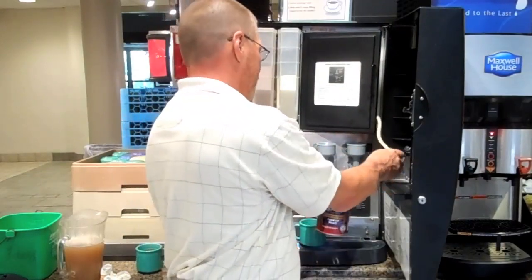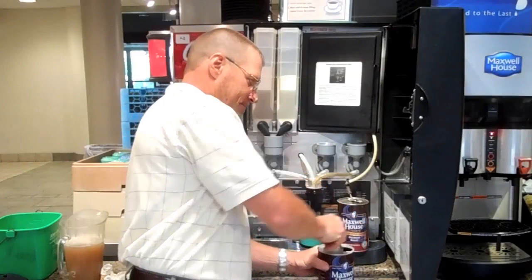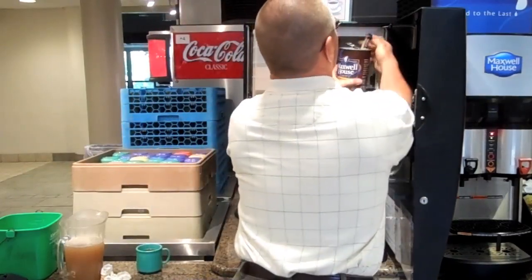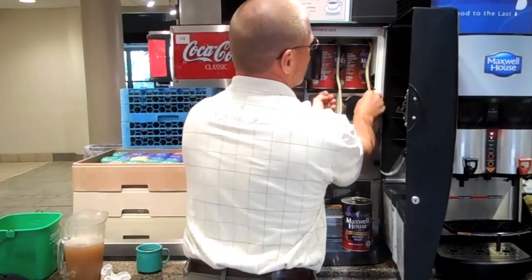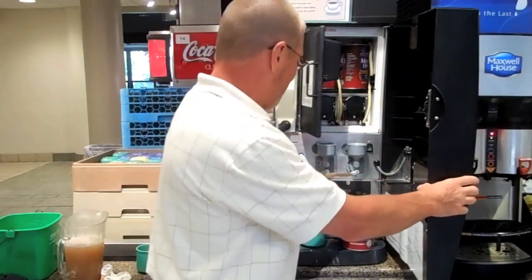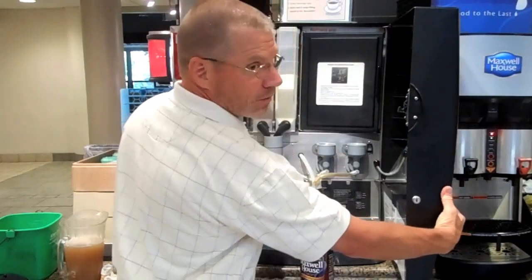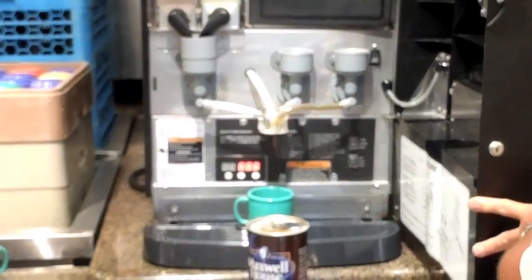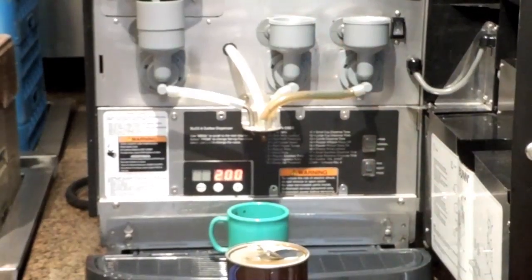Hot water, put it on prime, rinse that off, and then you're good to go. We have a new can — simply pop the top, put the probe into the can, place the can on the shelf. I always twist the can so that the hose is in the back, so you can make sure it's snapped into place and out of the way so the door will close. We still have it on prime because we want to bring coffee from here up into the tube and into the pump. Hold the coffee button down until you see coffee come out into the cup — that's pushing the hot water out and bringing the coffee in.